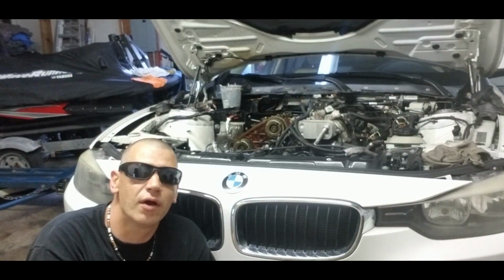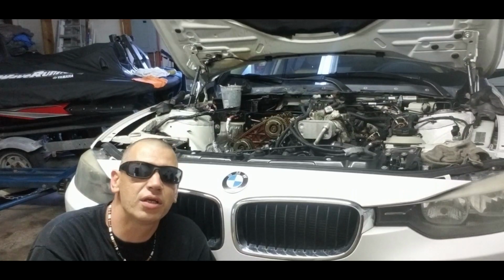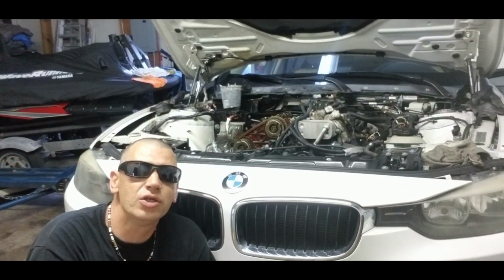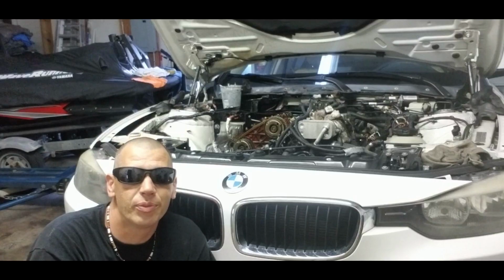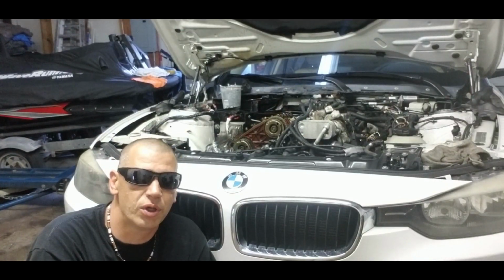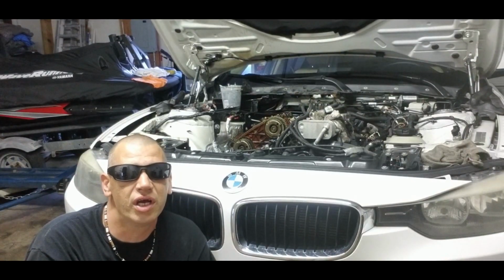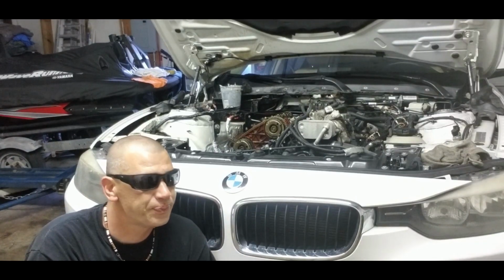sometimes the overheating just comes when the engine is already warmed up. But that one is not a head gasket, that one is a cracked head. If it has a cracked head, we need another head. No excuse. You cannot fix it.